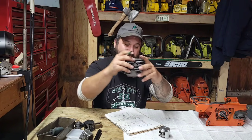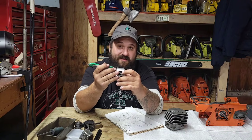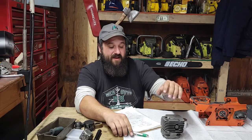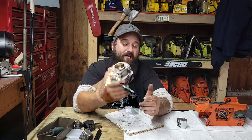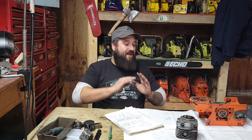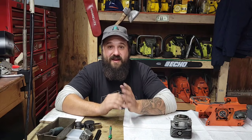Machining the cylinder base gets you more intake timing and less exhaust timing; cutting the pop-up gets more compression; cutting the piston skirt gives additional intake timing. I like to make these things flow a lot of air — the more air the better. Let's see what we can do with a 268 Highway cylinder and Highway piston, all off-the-shelf parts anybody can buy. In the next video we're going to grind and I'll show you exactly what I did, how I laid it out, and we'll do another build together. Thanks for watching — take it easy!